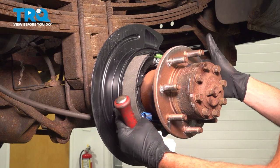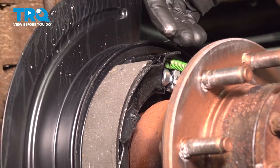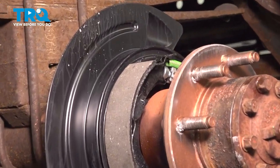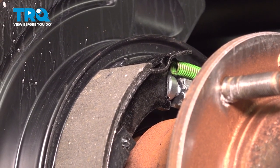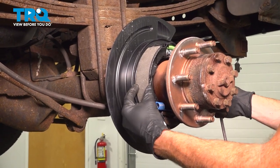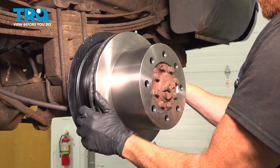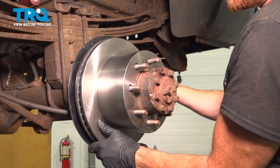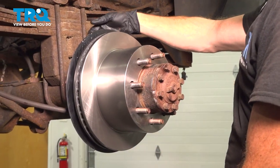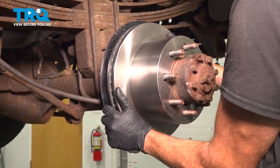We're at the point that we can start putting on our brake rotor. Before we do so, I want to talk to you about the adjuster. On the backing plate, there's a small slot that you can gain access from the backside making your way to this adjuster. You would use a small angled pry bar or screwdriver, come in through the backside, and you should be able to move this up or down to adjust the shoes out or in, depending on which way you spin it. We'll be taking the rotor, sliding it right on over here, and we'll make sure that the shoes are not hitting directly against it, because that will cause friction, cause heat, cause these to expand, and possibly lock up your wheel. I can spin this fairly freely. What I would want to do is make my way along the backside and make an adjustment with that cog until I feel just a tiny bit of drag — a little bit of resistance. Once I've done that, I'll just back it off a tiny bit so there is no drag, and then we can continue.